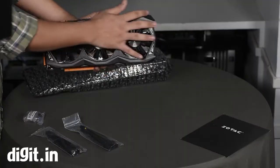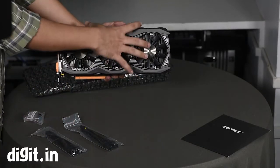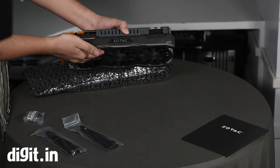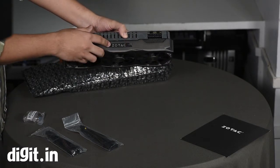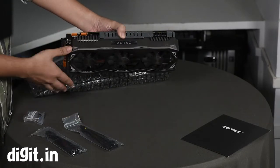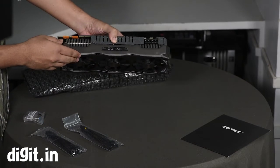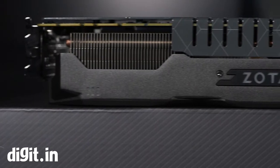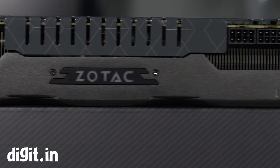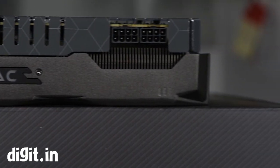The Carbon Exo Armor is something we've seen before, but the previous 980 had a small protrusion on top with load indicators called the Light ID. We see something similar here, but nothing is mentioned on the box so we can't say for certain. Since this card has a significant overclock over a stock card, it requires an ample amount of power, which is why it uses two eight-pin connectors instead of one six-pin and one eight-pin like the stock card.